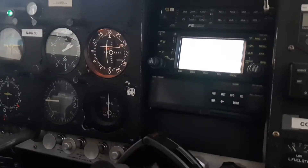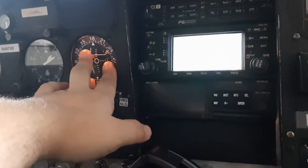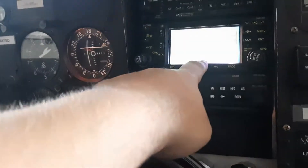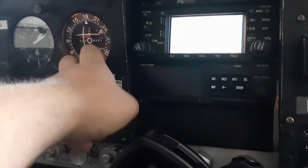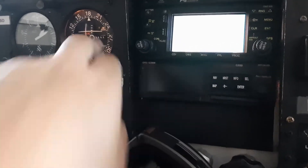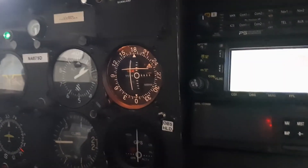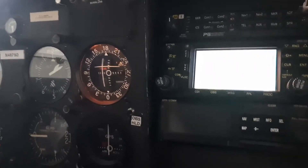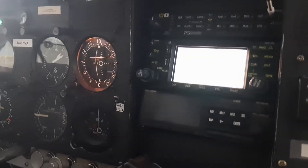This is important to do — it affects your ability for the VOR to be accurate. The OBS needs to be consistent within itself; you don't want it to vary too terribly much. This one varied from minus two to plus two, and the digital GPS is centered correctly on the offsets of the analog OBS. I had to have this one overhauled once because there was a 60-degree arc where the number would just bounce back and forth by plus or minus 10, which is not okay if you're relying on that to navigate.